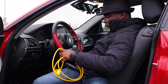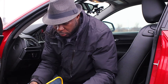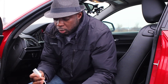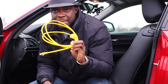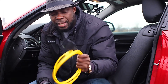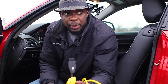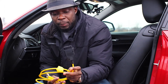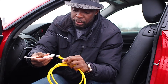With Boot Mode, there is some hardware required, but these hardware pieces are not going to be installed in the car — they are just going to help you flash the ECU. You will need an Ethernet adapter, and you will need this cable called the E-Net cable. It has an Ethernet connector on one end and an OBD connector on the other. You connect the OBD part into the OBD port in the car, and the other end goes into the adapter.